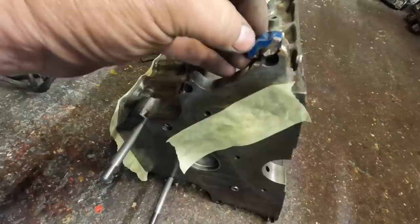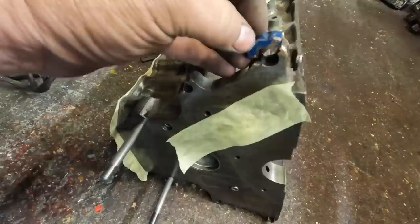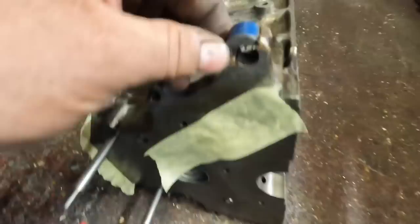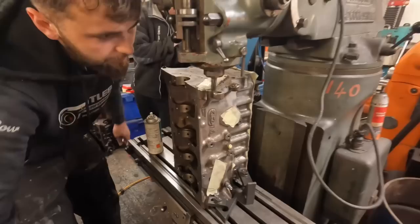On the Formula Ford, I'm trying to repair the lugs that have come off the bell housing part of the block. I've got to work out exactly where the bits go, clean them up, and get ready to weld it back together. To do this I've got out the old stick welder and I've been and got some cast iron welding rods from Newby Welding Supplies. I'm going to do a little bit of prep work, prep up the block, prep up these broken bits of lug, and then try and stick weld it back together.